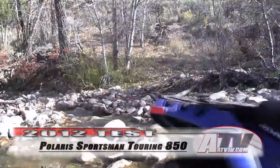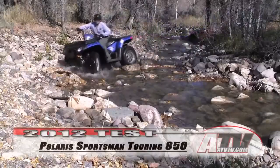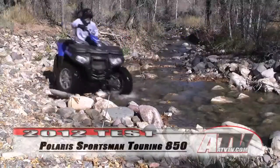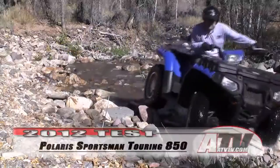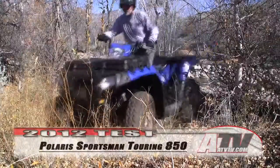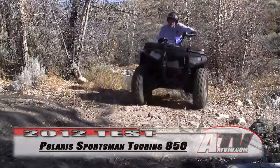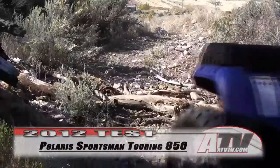Another huge problem for us was that even in all-wheel drive and going downhill with the ADC system switched on, the whole process gets thrown away if you use the foot brake. All of a sudden, the ADC forgets its job, and once again, you have all of the slowing and stopping power going only to the rear wheels. It's both weird and scary.